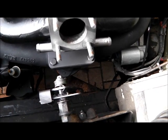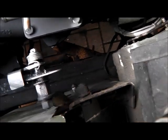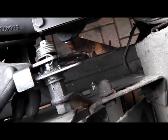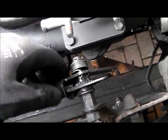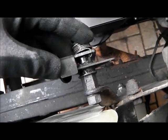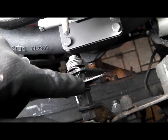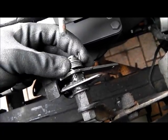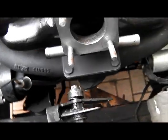I thought there was no way the carburetor would go on there, and it won't with that bracket in place. So it is actually necessary to remove those two bolts and remove the bracket, as the instructions do say. I'm fitting the new shortened linkage with it bolted in place because it's easier to work on that way. What I have had to do is put a little twist on the end of the return spring, because it had a habit of wanting to jump out — having had the throttle jam open once before, I don't want it happening again.